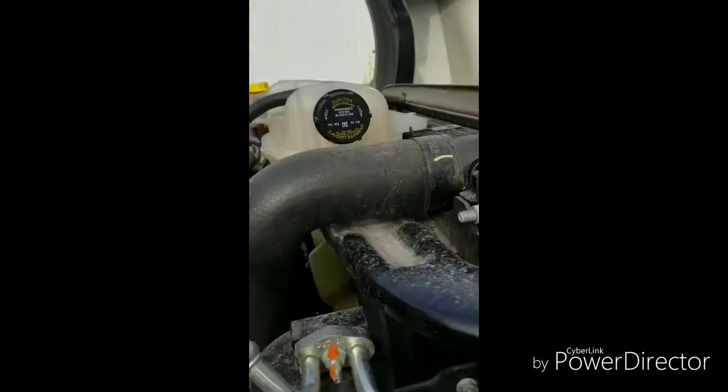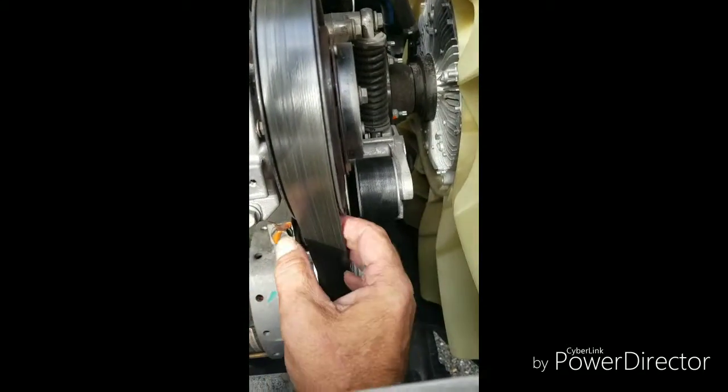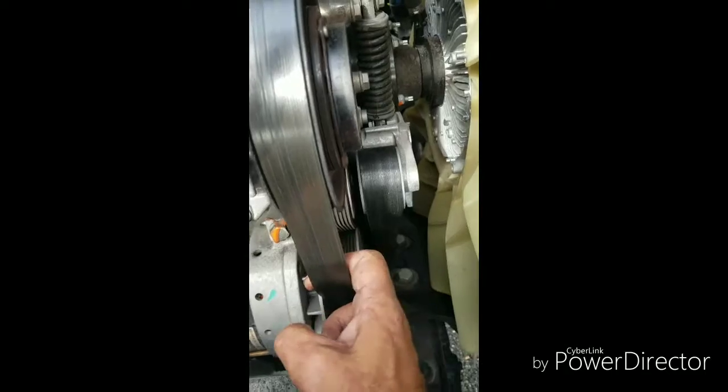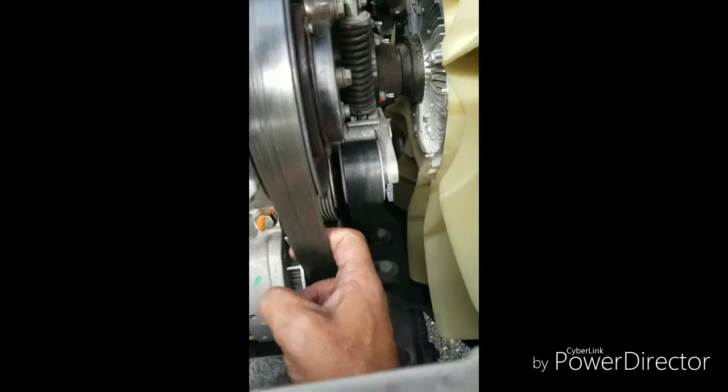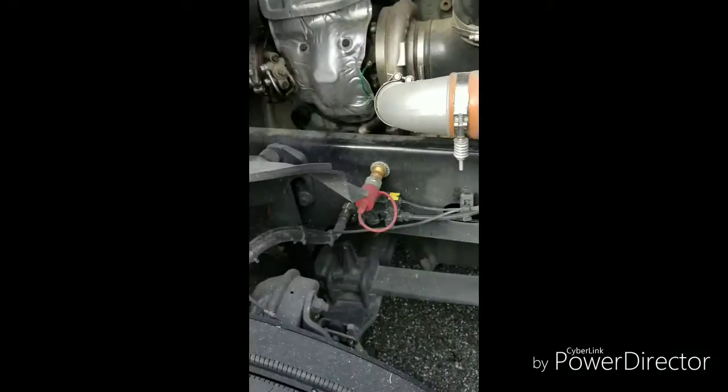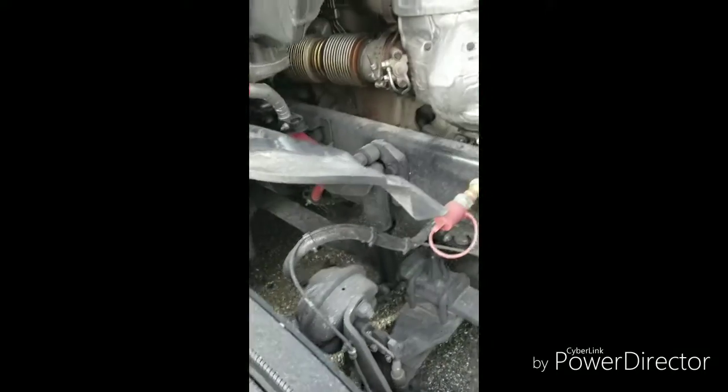You want to look at your water lines and hoses to make sure nothing's leaking. Check the tightness on this belt — there should be no more than about half an inch to an inch of slack when you pull on it. Make sure you look at everything: your frame rails, your suspension, your shocks — make sure there's nothing broke, missing, cracked, or bent.